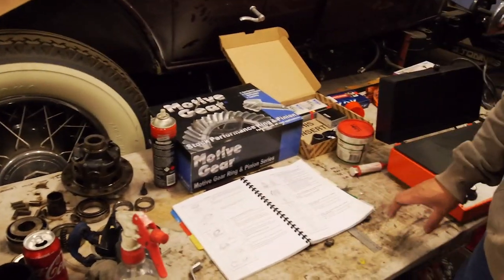So, a couple of things we want to keep in mind along the process of this whole thing. Number one, we will also heat the bearings to help ease them onto the journal. Before we do that, we're going to mic the journals and measure them up. When you heat the bearings to press them on, you need to make sure that when they cool down, they stay perfectly abutted against the flange that they need to go up against, because they will shrink as they cool down. No one ever does that.